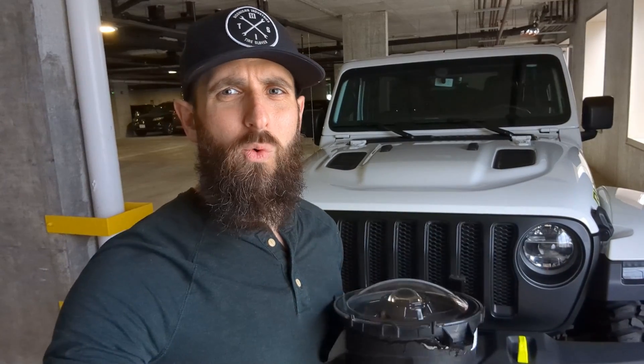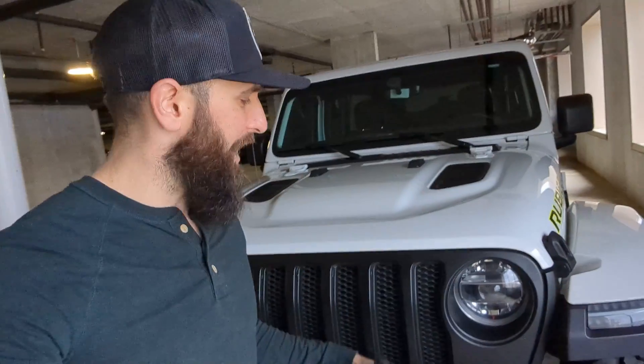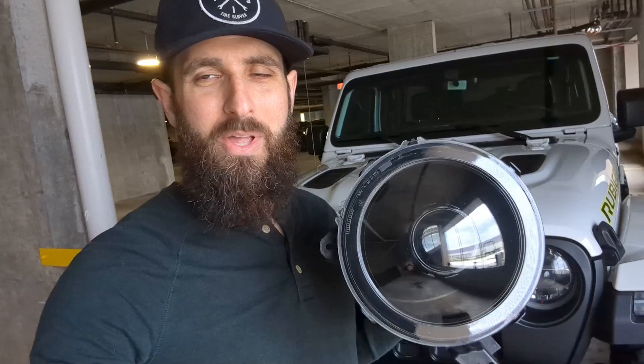Most people are going to wonder why am I replacing the Mopar LED headlights with retrofit HID headlights. The reason is my vehicle came with halogen headlights, and when you put in the stock Mopar LED headlights, the problem is the halo ring and high beams don't work — you need to purchase a wiring harness or wire them up yourself. So because I'm not a fan of the halogen headlights, I decided to go with retrofitting my own, without a halo, but still getting the same performance.